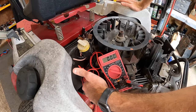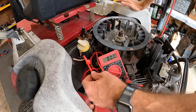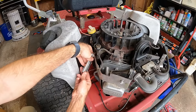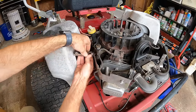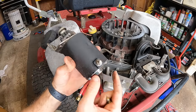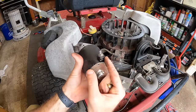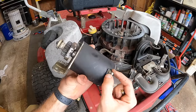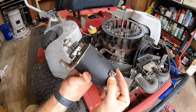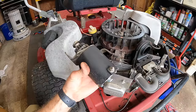I'm gonna see if I can just pop the starter off and take a look to see if I've got another one. Got these cracked loose a second ago. These are a T40 bit, and the starter's out. So you guys can see now that this thing was just dangling there. These do actually break quite frequently. You can put some JB Weld in there and put it back as long as the wire connections are still good. So let me see what I got in the stash pile.